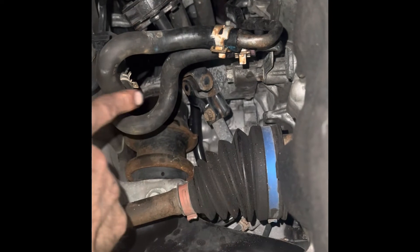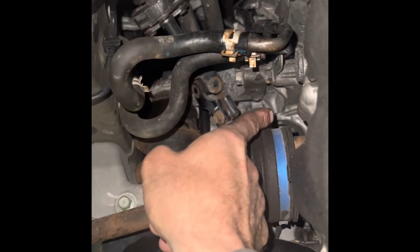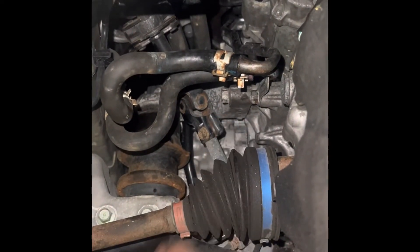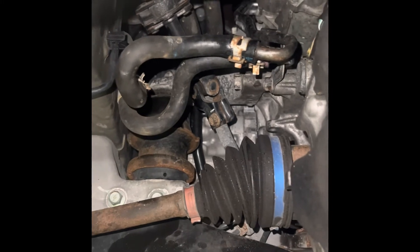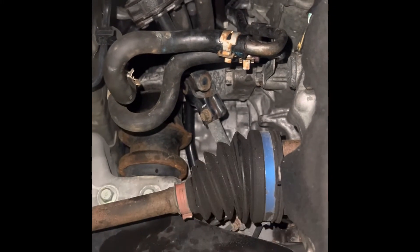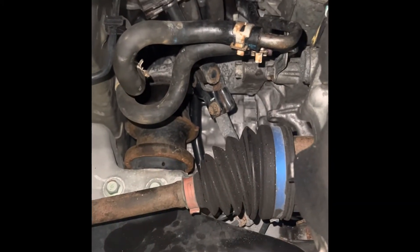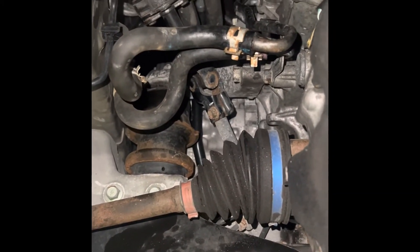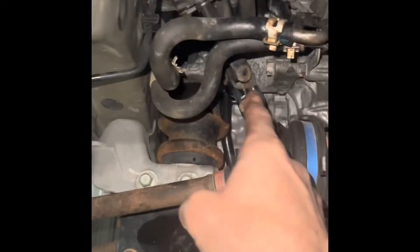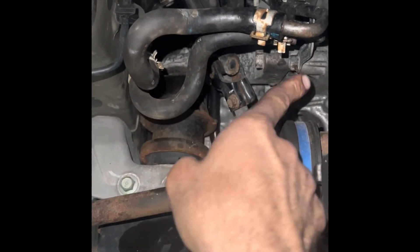This mount on the driver's side when I was putting it back together had shifted, and that one bolt you can't pull out because it hits a frame rail had slid back between the bell housing and the transmission. I didn't see it — I was up top trying to figure out why they weren't pulling together. I thought it wasn't square to the engine and the dowel pins were catching, but then I looked down and saw it, so I had to come back down and go backwards. Keep an eye on that mount and that big bolt that goes all the way through, because it will slide back and get in your way.